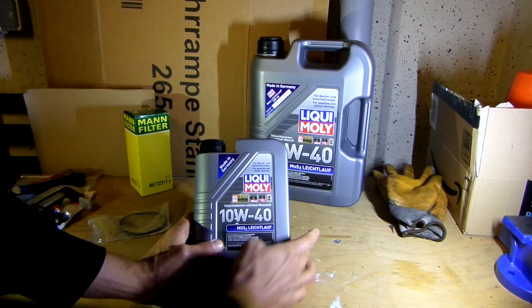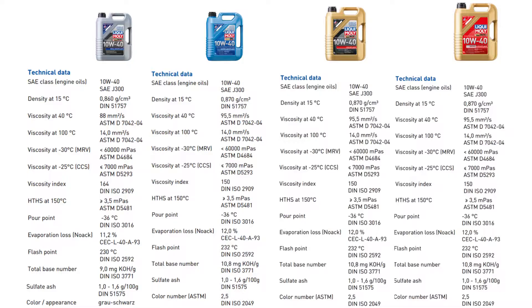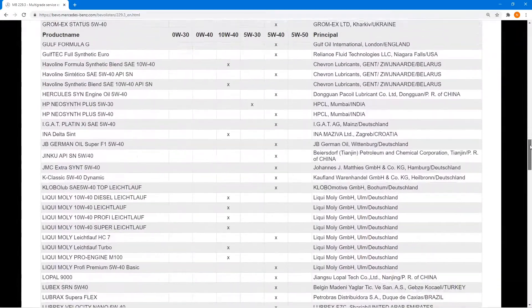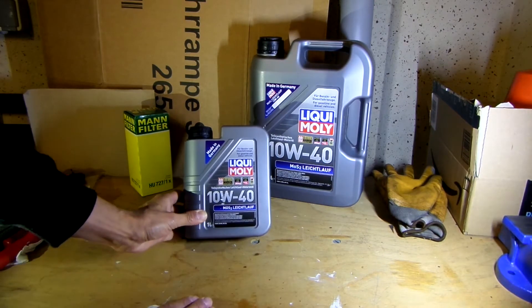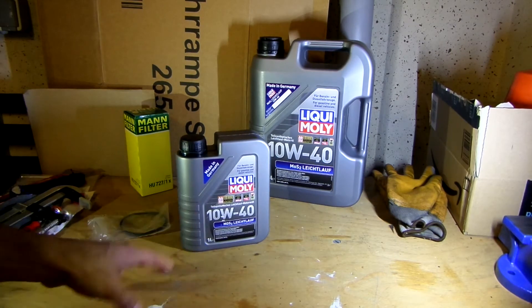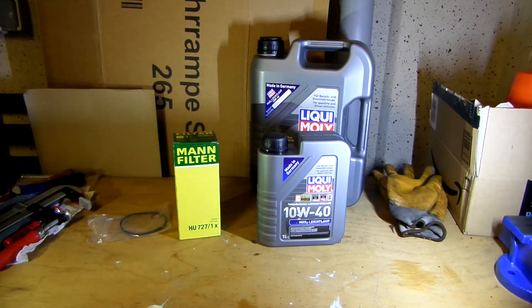The oil I'm using is a bit thicker than what I normally use and actually not approved by Daimler for this engine. In fact, nobody approves this oil. Its sister products, however, all carry the necessary approvals, so I will go ahead and use it anyway. The second property of this oil is the addition of liquefied molybdenum disulfide, or simply moly, spelled with one L — now you know where the company's name came from. Along with the job, of course, also comes a filter change. Neither of these products were sponsored in any way.